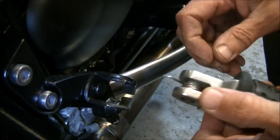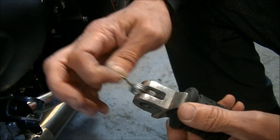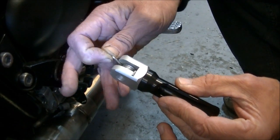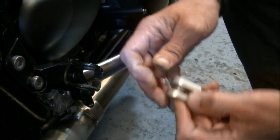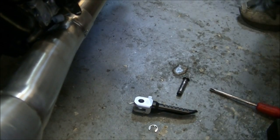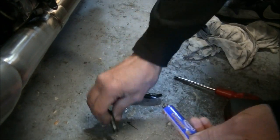Just hold that there, and before you let it all drop on the floor in a heap, just regard it — look at it, observe, see how that goes in so you can see how to put it back together. When we get the new one — that's exactly how it's going to go in, just like that. So we do that first. Now I'm going to use a little bit of soft copper slip, just clean the cotter pin off. You just want a very thin film of copper slip on that.